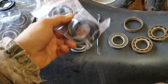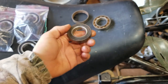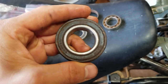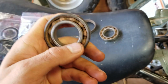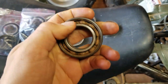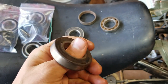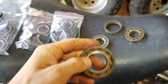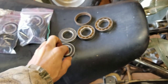The front kit comes with two oil seals. Here are the original bearings — this is a Koyo Romanian bearing — and you can see there's no grease in them. The previous owner treated this thing like a boat, and the seals were blown on the axle shafts and everything. I'm going to pack more grease in these bearings because the tiny amount they include is what I've already done to all of these — I'll show you on this one.